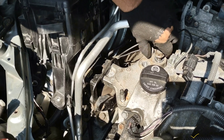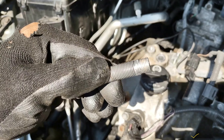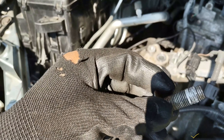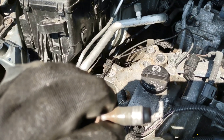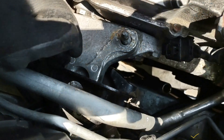All these bolts — I hope the camera can pick this up — the bolt is terrible. See that thread right there and this part here. The thread on this other one is all messed up too. I don't know what kind of job they did here — they cross-threaded it. All the bolts are like that, and this is the motor mount here that I've basically unbolted.